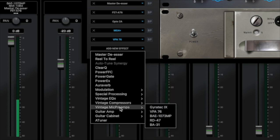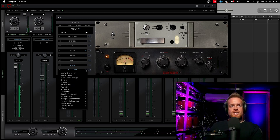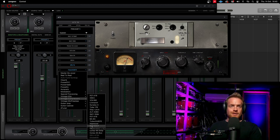We don't need any more EQ. So this is just for demonstration purposes while I'm faffing around here. Let's go for another compressor. Why not? Okay, so we are limited to 8. But as you can see, the DSP has allowed us to use all of these, and there's still processing power available. That's brilliant. Now, if at this point you're wondering what that slightly weird phasing is, as if there's another microphone being recorded, which there isn't, I'm about to tell you.